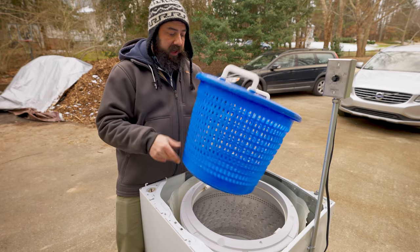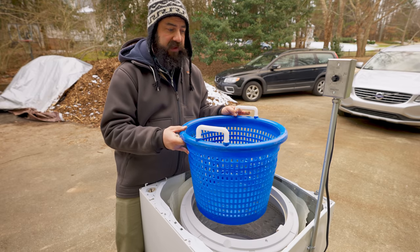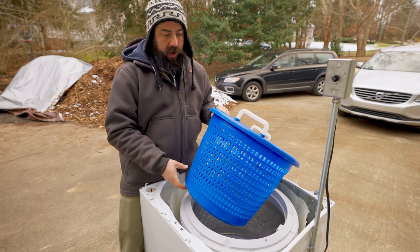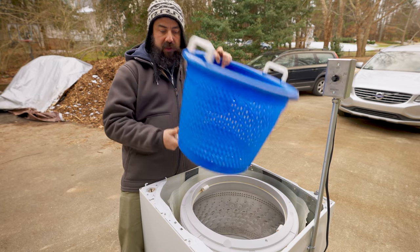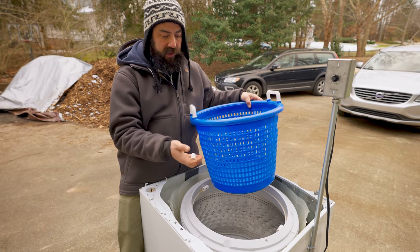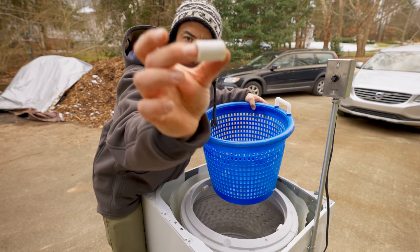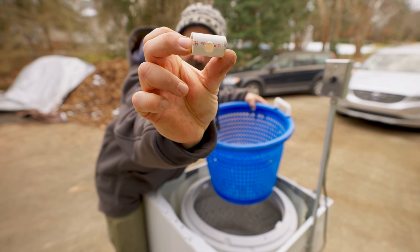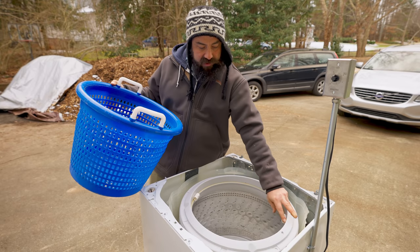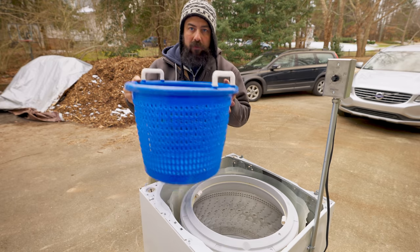One thing to note about the basket: when you drop it in this washing machine it doesn't fit snugly — it kind of moves around, which doesn't feel great when running. My old machine it sat in pretty firmly, but this one is a little wider inside. The basket is tapered, so really you're trying to grip it towards the top. To fix this, we're using half-inch PVC pieces cut an inch and a half long, pre-drilled on one side with a bigger hole on the other so the screw head goes through without sticking out where the basket rubs. We'll put in four of these and hopefully that should hold it secure.